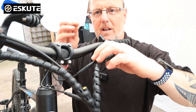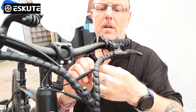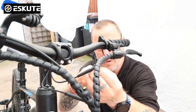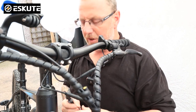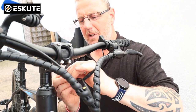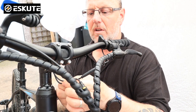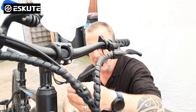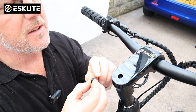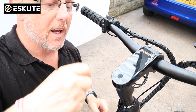I'm going to take a small cable tie and wrap it around this cable — leave it loose so it's tucked up out of the way, nip off the end and now that cable is nice and tidy at the top. I'm also going to take a second cable tie and just wrap it around these two cables — you don't need to but I just want to keep them relatively tight together so they don't flap around the handlebars. Just make sure you put your small rubber grommet back in — there's a slight cut out on the top and that goes face up. Push it back in and it stops any water getting into the top of that screw.